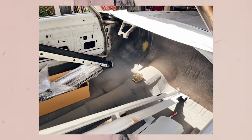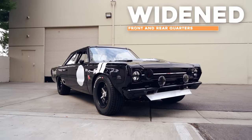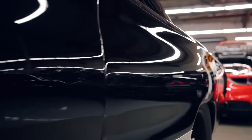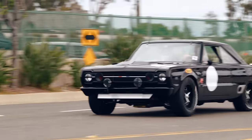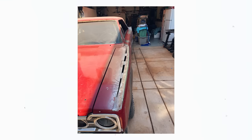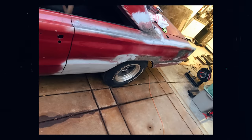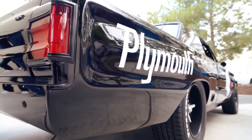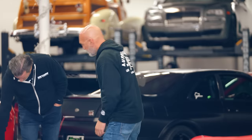You've widened both the front and rear on this car. I like hips on things — if you look down the front you'll notice the front fender is bowed out and the rear fender is bowed out, giving space for bigger tires. You just take a cutoff wheel, cut the entire fender all the way down the middle, take a wooden buck and pull it out, then stitch it back together. Same thing on the back. The rear openings are redone to give the extra width, and there's a little air vent that blows air into the trunk to clear out any gas fumes.